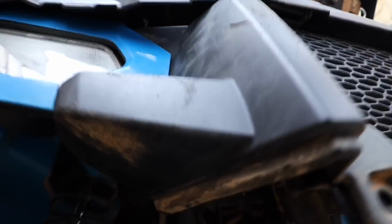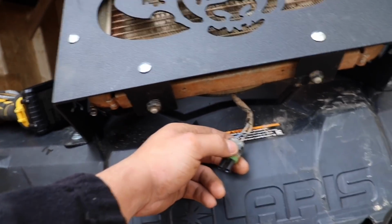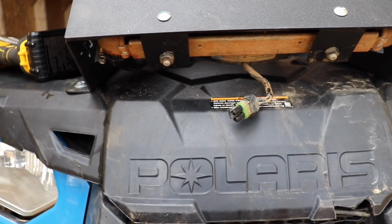All right, so we have the connections ran, got it clamped, hose ran down, and into this, like I said, we put it to a 90, clamp on both sides. We just use a factory one since, you know, those seem to work pretty well. And then on this side, we connected it with the extender to here, clamp, factory one. We ran it up to the bottom piece. We probably could have just drilled a hole through the lid, but for now we're just gonna leave it like this. And after that, what's next, you have to extend this power adapter. So you're gonna wanna cut it like around here. Your kit should come with extra electrical wiring, and you just adapt that, wrap that with tape or waterproof it somehow, and other than that, you should be set.